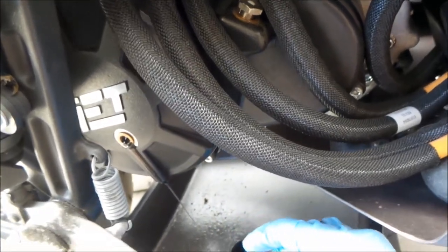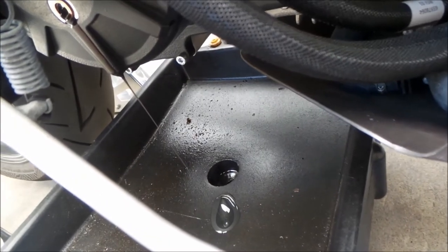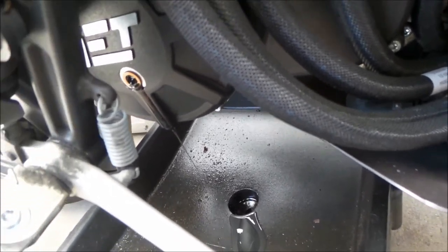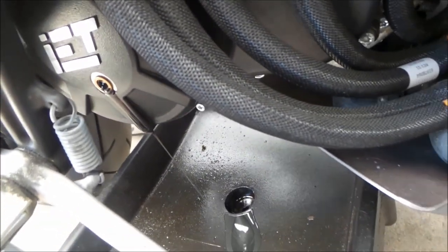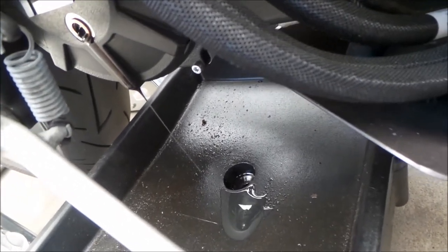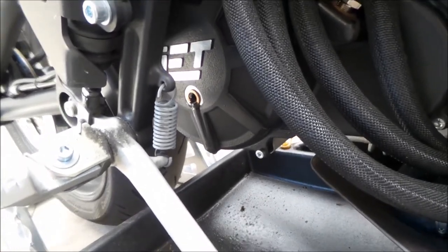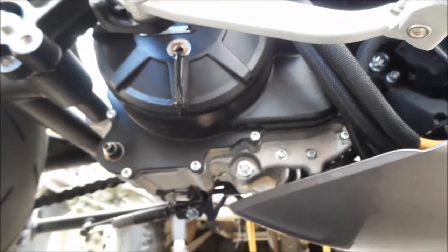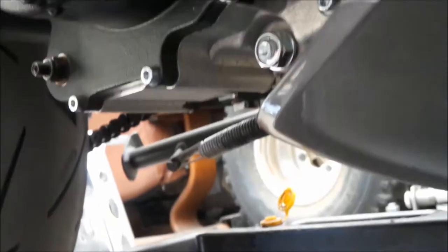Yeah, a lot of oil came out. It's pretty nasty. It does remind me of gear oil — there's a lot of really fine metal shavings in it. That kind of leads me to believe the transmission is overfilled on this bike. Right under there is the drain plug, and as you can see it's kind of alarming because there's a lot of dirt around it. The only reason there would be dirt there is if oil was leaking from it, so the transmission must be leaking some kind of oil.